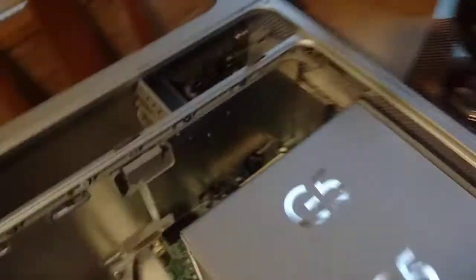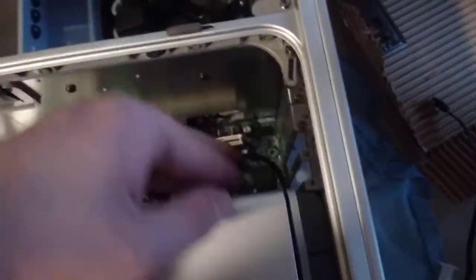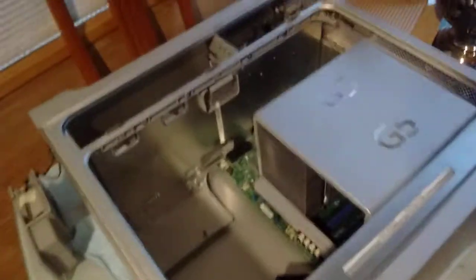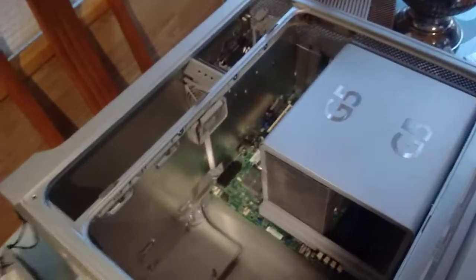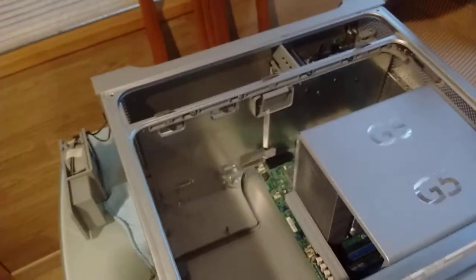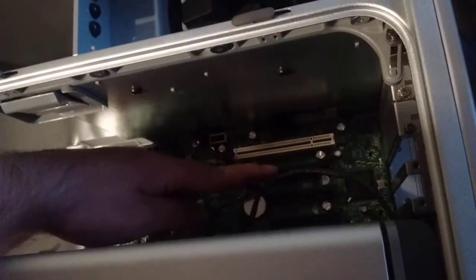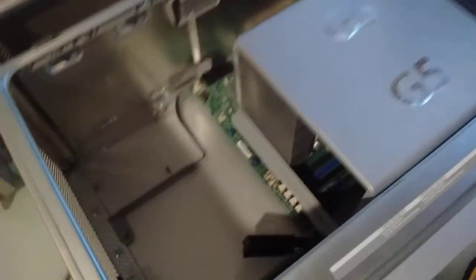I have a wireless card here — I was using it for test fitting. Something you'll notice if you look up the motherboard: it has three PCIe 8x slots — it doesn't have a 16x slot — but the top one, which is the bottom one in this system, is an open slot and does provide 75 watts, so you can use graphics cards no problem. It's PCI Express 2.0 so it won't bottleneck any graphics card with 8x bandwidth. The middle slot is 8x and the other is 4x because this is an Intel chip.